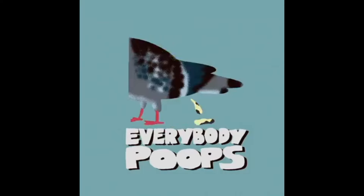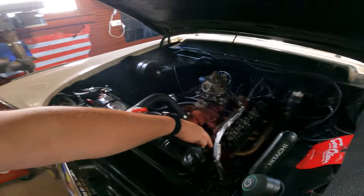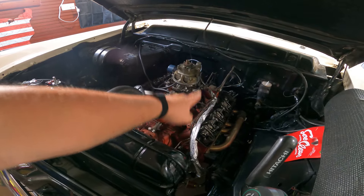On the way back, the car started running really badly. So I brought it in and figured I'd fix the valve cover leak. I had to order a new gasket set. While waiting, I wondered why it was running like crap — I thought it was vapor locking again, because this car is infamous for that. I also had the valve cover off and noticed it started clicking again, basically sounding like a diesel truck.